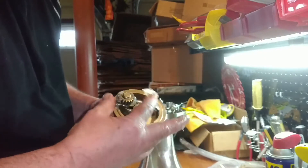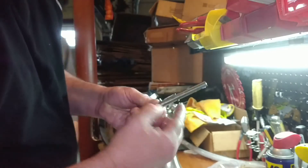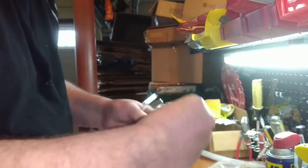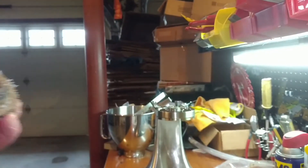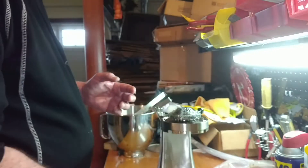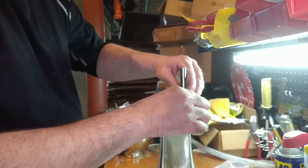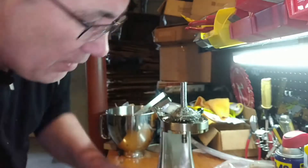We're packing all these gears full of grease — it's a messy job. If you don't want to get your hands dirty, you might take it to somebody who doesn't mind. There's a little pin that engages with the top gear; just put that back in place. Lube up your gears completely, and here you can see that thrust washer or bearing. Go ahead and put the center shaft back in — that's where the seal goes. Place it in there with the pin and it presses down nice and snug.